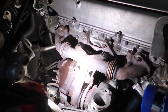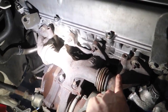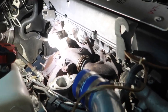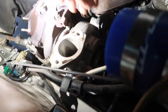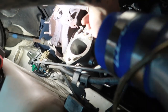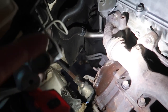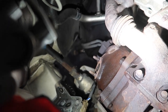Now coming to the most interesting part — the turbo manifold and turbo itself. I never knew how restrictive the turbo manifolds are on the 1JZ. While I'm here I might as well buy a new top mount turbo manifold, right? Nah, just kidding — we've got to take care of the Skyline first. Turbo seems to be in good shape, though the gaskets are pretty much shot. In terms of play for the turbine wheel, I can't move it left and right but I can move it forward and back a little bit — I'm not sure if that's concerning. But it's running great. Behind here we have full access to all the bolts from the turbo to the stock elbow dump pipe, though these were pretty loose too.